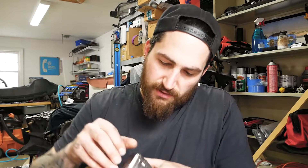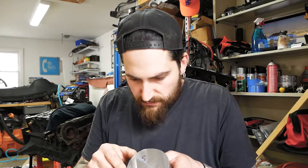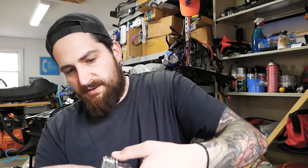The way we're doing it: take the oil ring expander, throw that in first, put that in, then take your oil ring rails — corner in first — bring it all the way around. Then take your second ring, same way, hold it at the corner.